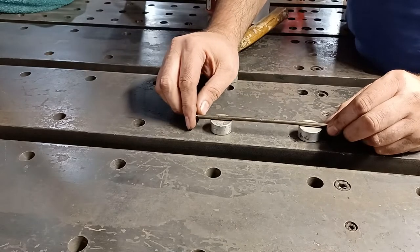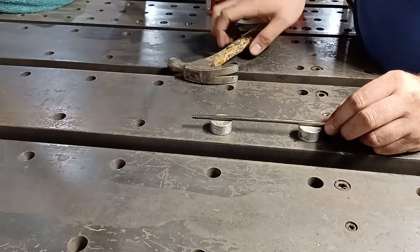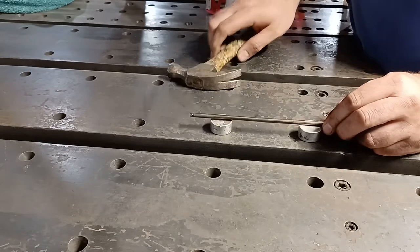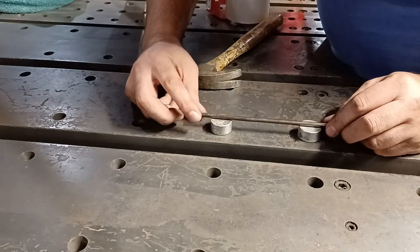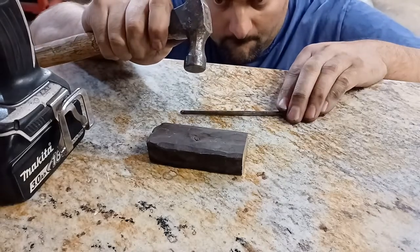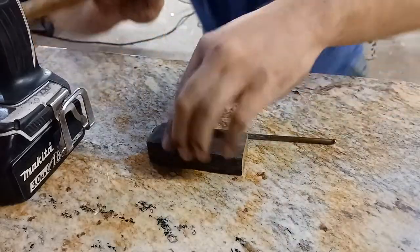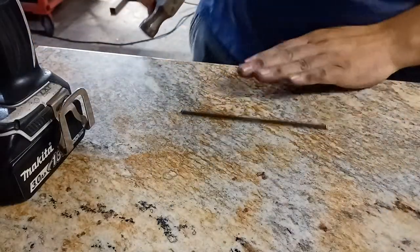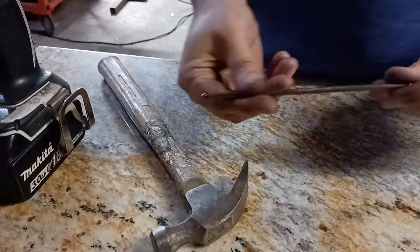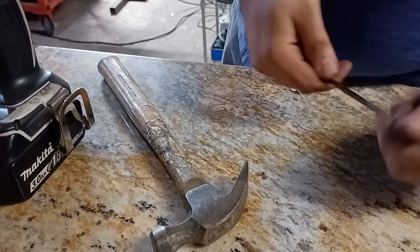And this is not a high RPM motor with lots of tension. The only thing that's going to bend this is if the valve guide pushes out and the system binds up. Otherwise, there's very little pressure on this. Eyeballing it is going to be good enough. All right, pretty good, considering it looked like a banana before. So that'll work. That will get us mowing for the rest of the season until our new head and new push rods come in.